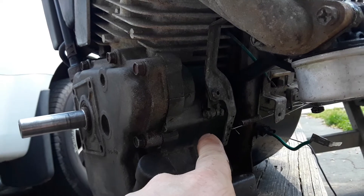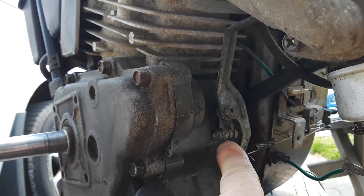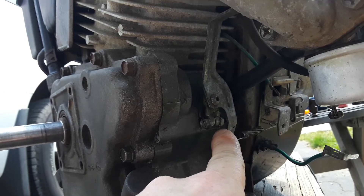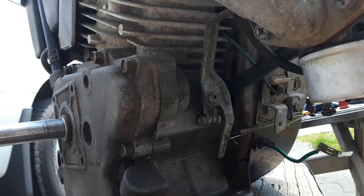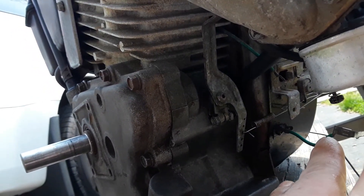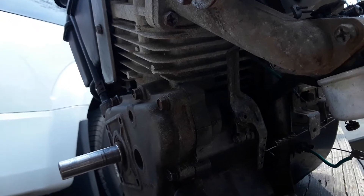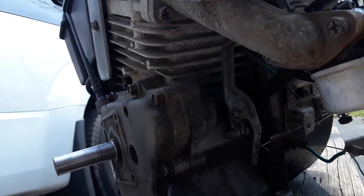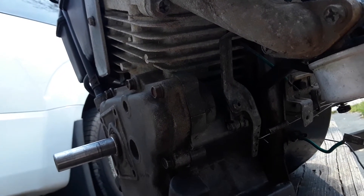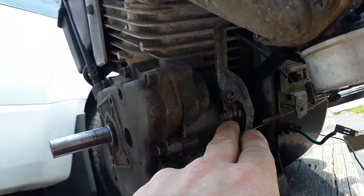But it's a fatal design flaw. The oil leaks right out the block where the governor arm goes in. It's a widespread issue on all of these. There isn't really anything you can do to fix it, because even if you do fix it, it's going to do it again really soon. My advice is, if you can, stay away from this engine and anything this engine is on. If you have one, get rid of it and put a Predator on, because these engines have a fatal design flaw right there where the oil is leaking out the governor arm.